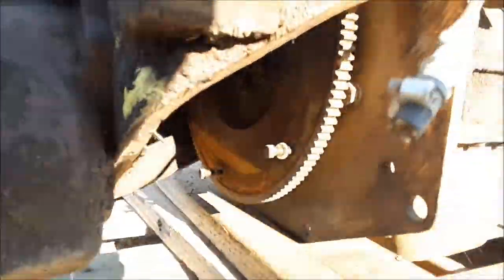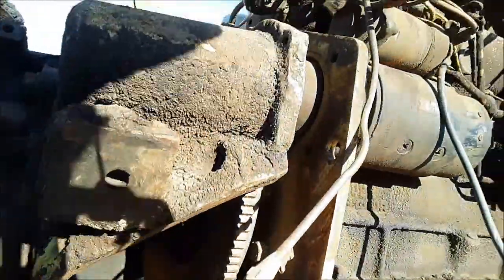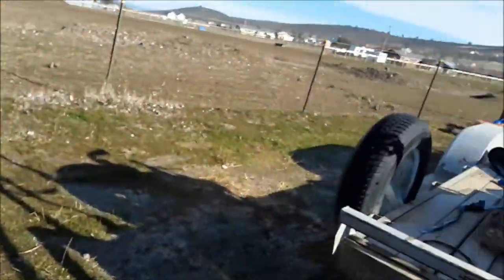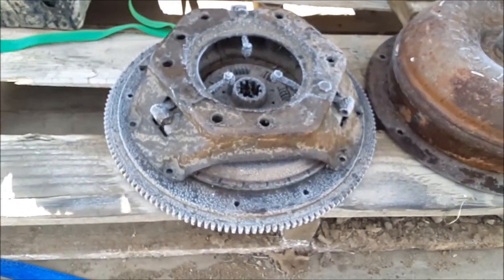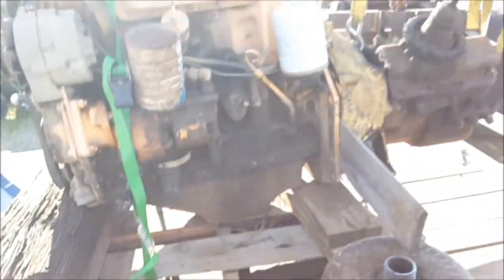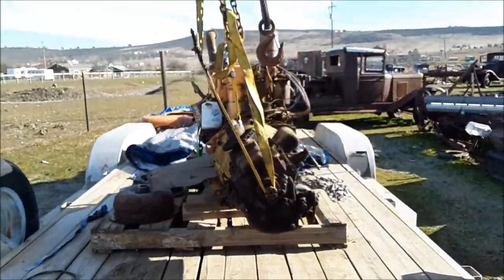So I took the torque converter off, and it needs a little bit of modifying done to that flywheel before clutch will go on, but if I'm desperate enough, this flywheel is the one that I plan to use the clutch and clutch plate off of on that one if I can. But if I'm desperate enough, I'll put this flywheel on, because the bolt holes are the same spot. So I just need to figure out how to move that and build some way of hooking it on.